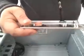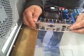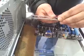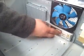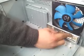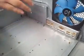When you put this faceplate up against the motherboard right here, you're going to see that it's got some pegs that sit up, some pegs that sit down. I'm just going to take the pegs that are going to sit up, like these right here, and I know these are going to sit up. I'm going to pre-bend those out so they're not in the way of anything. And that's pretty much it. We're going to take the faceplate, put it in, start from the bottom, and snap it right in at the top here. You don't want to bend the faceplate at all, okay? You bend the faceplate, things aren't going to sit well, and you're going to be hating life. The faceplate's very flimsy. See that? Stuck right in there. So now our motherboard is going to be compatible to slide right in there.